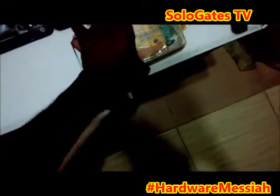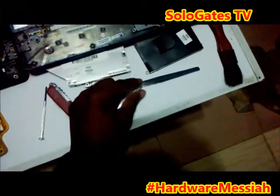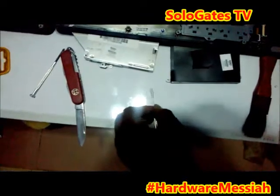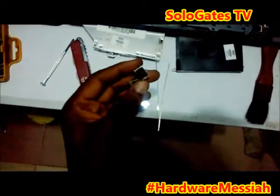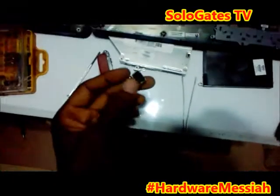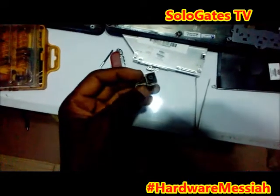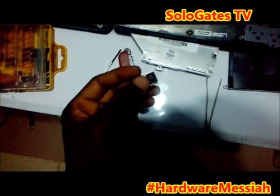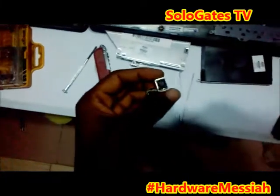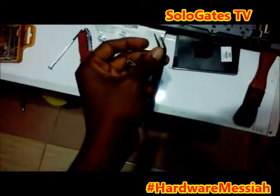If you are smart, that will be the first thing you check. All I did was grab my picker — you can see how it looks, it's a screw picker, like tongues or tongs. I use this to work within the hole and try to push up the metallic stripes. When I did that it brought the connection stripes up a bit — they were embedded after long use, which is possibly going to happen to a lot of HP chargers. You just have to pull them up and it re-establishes contact.